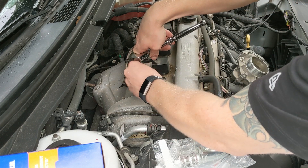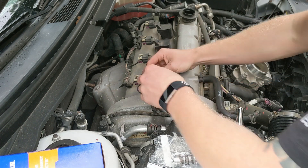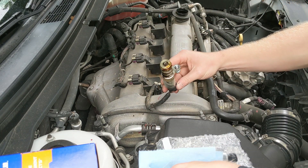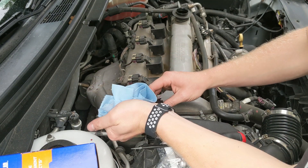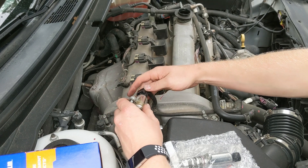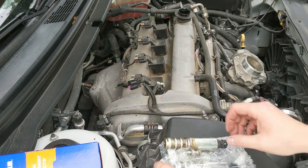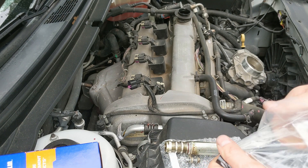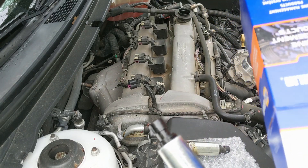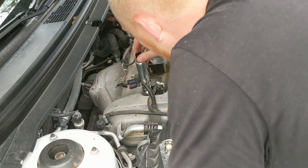Keep in mind, if you've run your car before, there's probably going to be oil on this, so just be careful — you might want to grab a rag. It might take some pressure to get this thing out. Be careful, you might have some debris on top of your valve cover — don't let it fall in the hole. To get the connector off, come in from the bottom side with a screwdriver and push up on the tab. And we basically have the exact same thing here in the packaging — go ahead and open it up. There's the part number if you get it from Napa for the exhaust side.